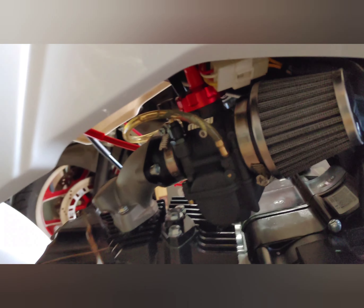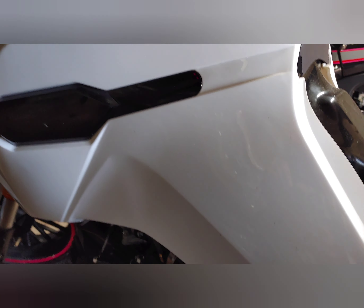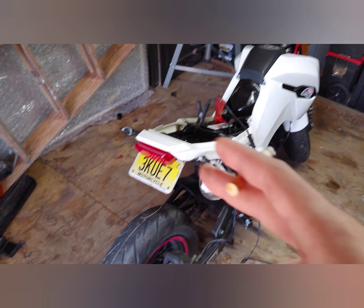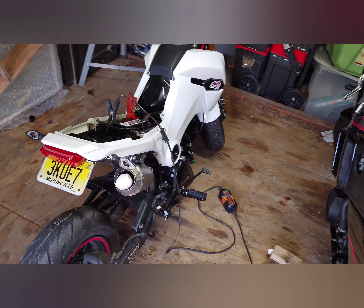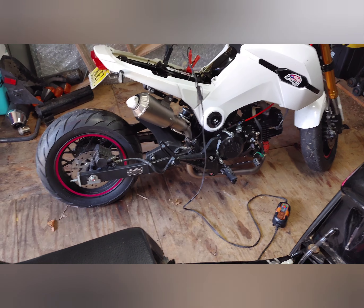The build was basically plug and play for me as far as wiring goes — the wiring is behind this cover here. I did not have to splice into any wiring because this Fuerza did come with a neutral wire. The only thing I did change was the rectifier down there, because when I turned the bike on the headlights weren't working. Swapping the rectifier corrected the issue.